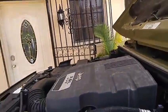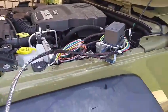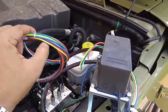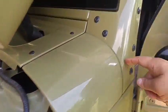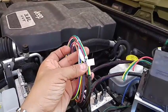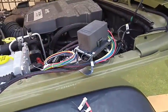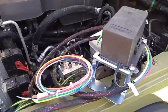One little detail: you can custom order these S-pods. Typically the S-pod as sold comes with 36-inch-length cables, but because of my setup I wanted an easier time reaching down through here and up through my column, so I asked that they be made with 12 extra inches — that's 48 inches — just for the cables going to the switch. That'll cost just a little extra dollars, but I think it's well worth it. You can ask the eBay manufacturer for that customization.